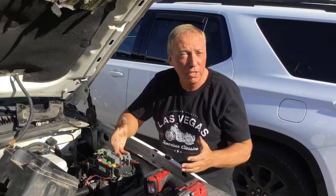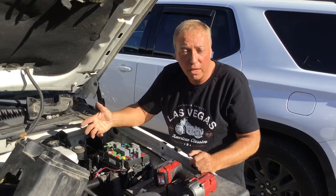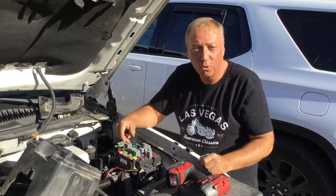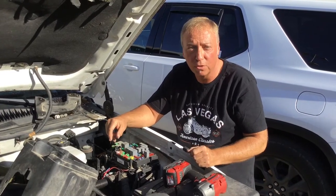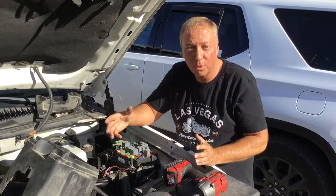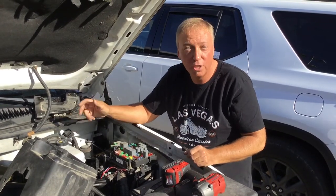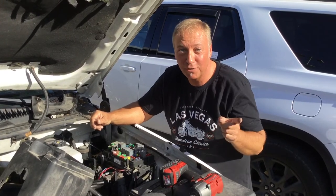The only thing we can figure is this truck didn't come out with that option — didn't come out with the rest of the wiring that goes into your plug and play control harness that goes over to your trailer brake controller. So if you're having the same problems, check that blue wire, pop your cover off, make your connection, and run an additional wire. Hope this helps you out. See you on the next video.